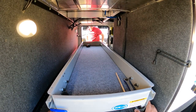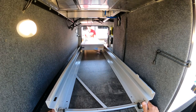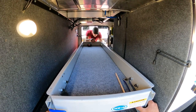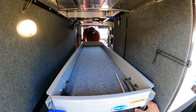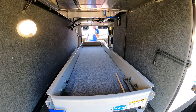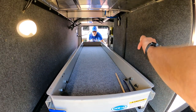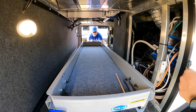Go ahead, I'll hold this. Go ahead and pull it your way. Let's make sure everything functions the way you want. That worked. Double check your distance and we'll call it good — we'll just measure off the one side. Right at six, and just under three and three-eighths. And I'm even on both sides. Perfect. Let's call it. We'll screw it down. You can get into your door. Perfect.